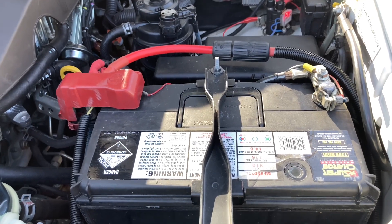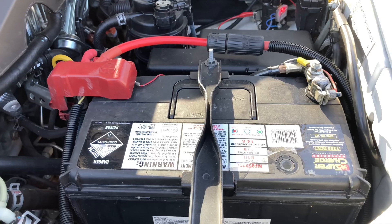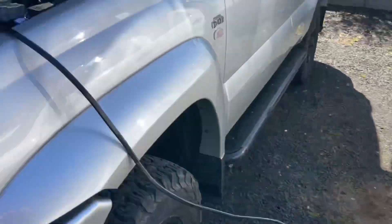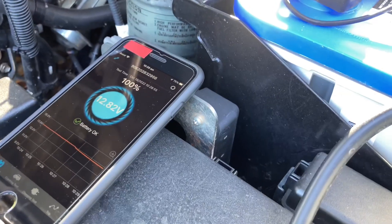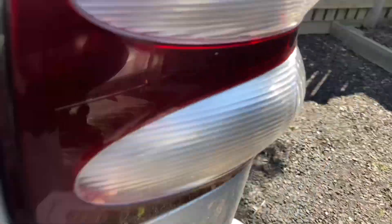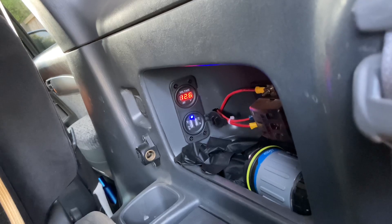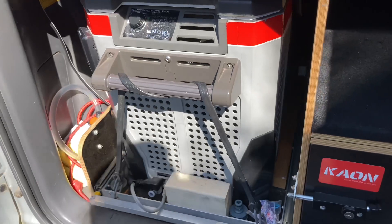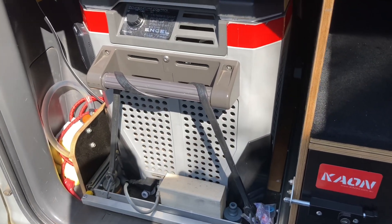Both batteries I like. Let's just go and have a final look and see what it is - 12.82. I'm sure the fridge is running. Right, that's where you see the load voltage at the lowest, closest to this area: 12.6. A fridge compressor will pull it down 0.4 to 0.5 of a volt when the compressor's running.